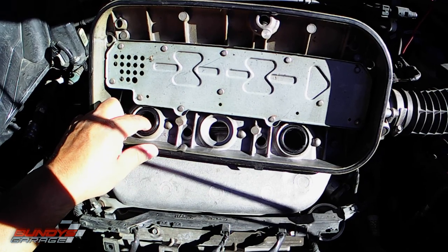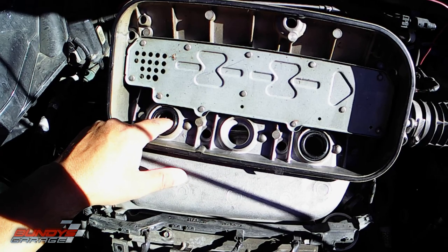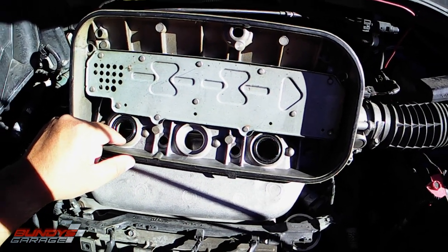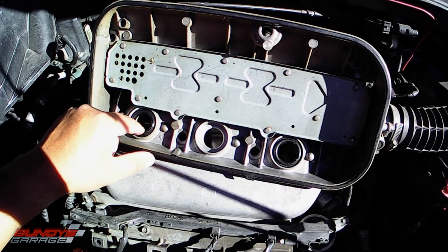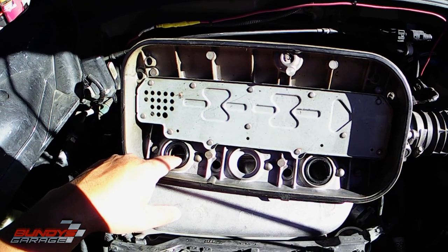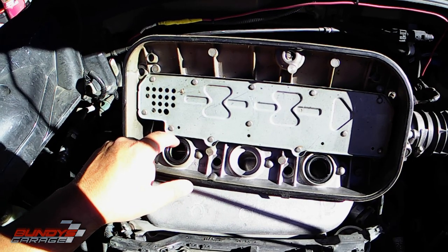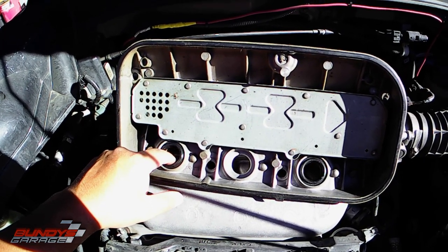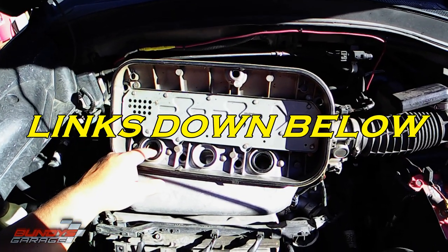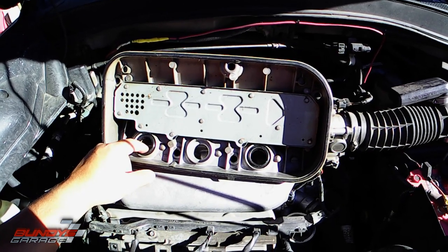Six total. These can get rock hard. Sometimes I've had to burn these off in the past with a propane torch to get them out. When you reinstall them, it's best if you can use Honda parts — Honda valve cover gasket, Honda oil tube seals. But if you can't, stay away from Felpro. My next best recommendation after Honda would be Victor Reinz. I'll put some links in the description below. I used Felpro for a while but kept getting leaks after 10,000 or 20,000 miles.